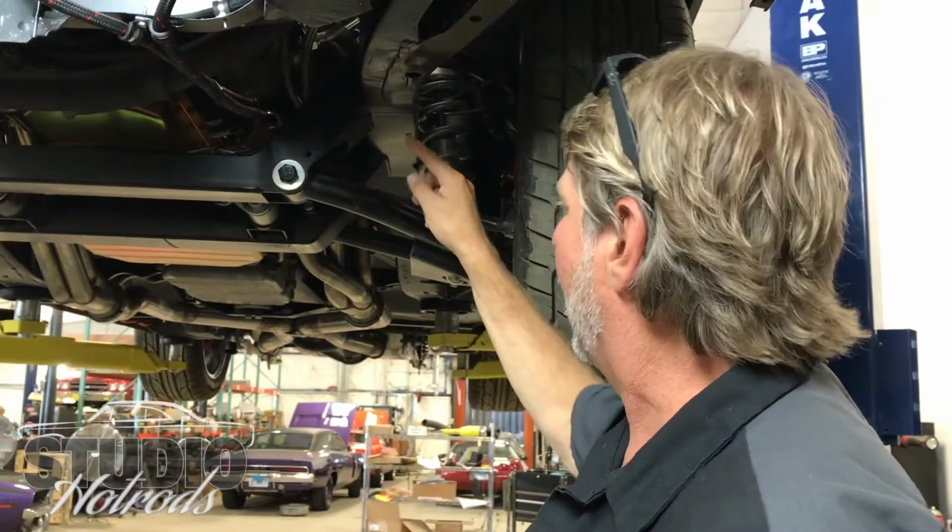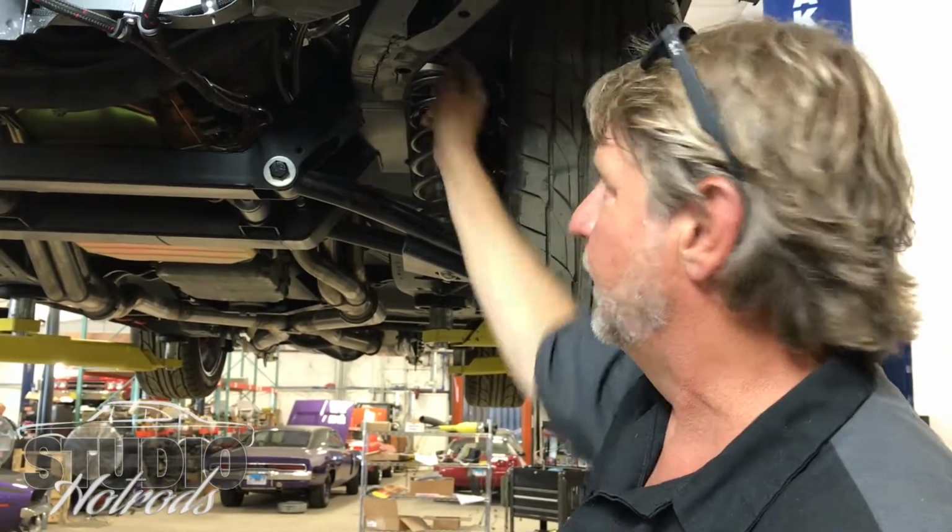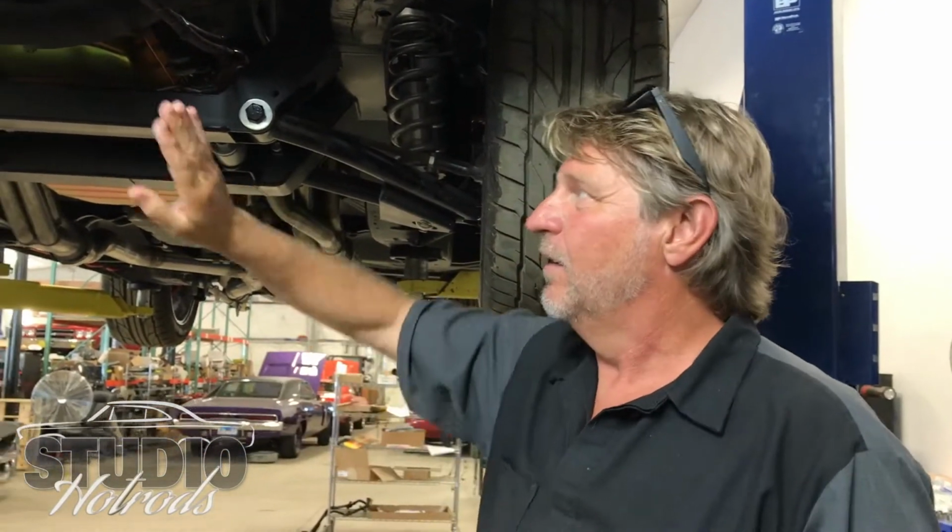Upper and lower control arms you buy, it's a kit, right? Yep. I think that was a Heidts product. So we make our stuff fit to that, but all the suspension, all the parts and pieces, and even the pockets that hold the top of the shocks, we had to custom make. The motor mounts, the headers, the cross member up front, all that's custom fabrication. You have to do that while it's on the chassis jig.